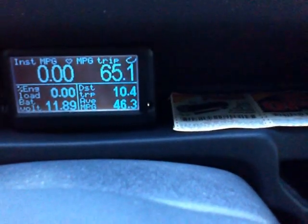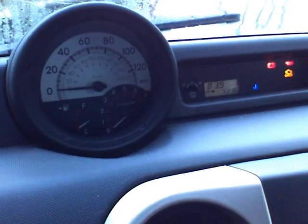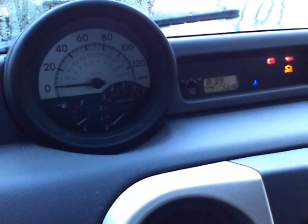The pulse and glide technique: basically you accelerate up to a certain speed with the engine on, keeping that load at about 83, watching the speedometer to get up to your speed. I'm trying to keep the RPMs from about 1500 to 2500. Second gear pulse will be about 12 to 20 miles per hour, third gear about 18 to 40 miles per hour, fourth gear about 25 to 40 miles per hour, and fifth gear pulses from about 40 to 55 or 45 to 60, depending on traffic conditions and posted speed limits.